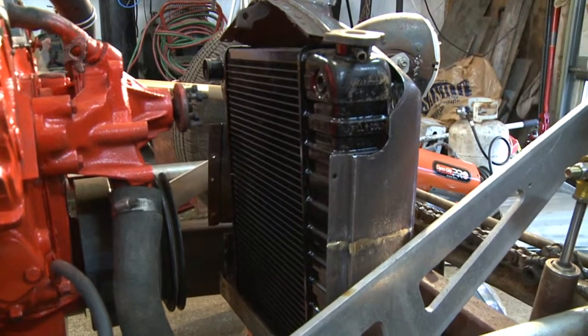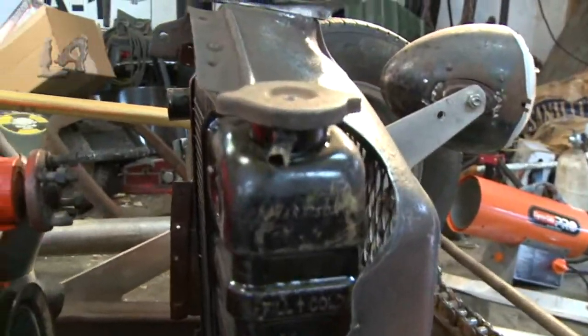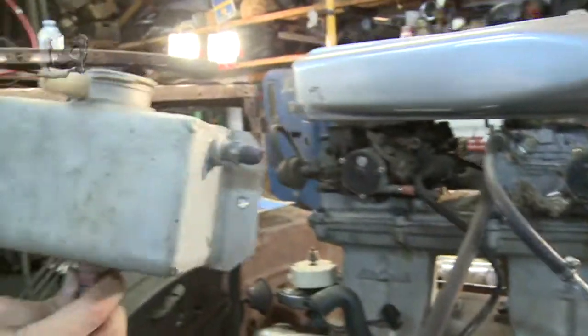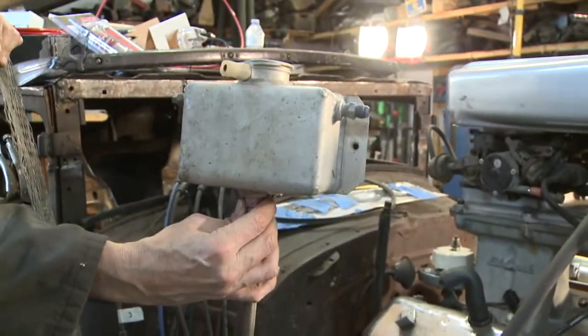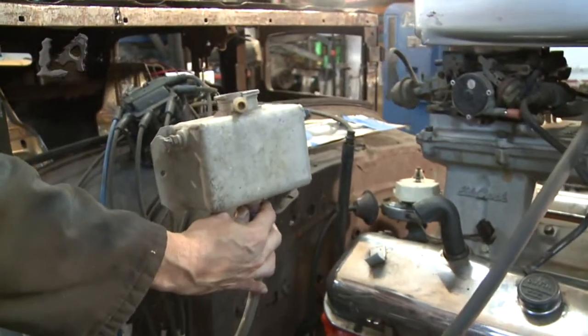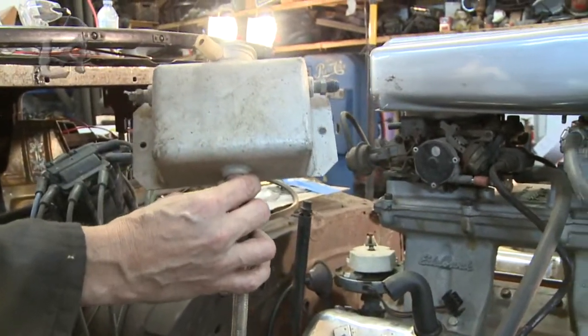Going along with the cooling system, the radiator cap is a little bit lower than the engine, so I'm not going to be able to fill it properly. I acquired a reservoir tank from an old race car — once again from a dirt track car. I'm going to mount it to the firewall; it will be high enough. Put my rad cap on there and problem solved. Another part I picked up — I got this one for free. They were going to throw it out.